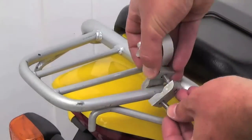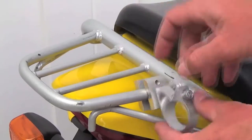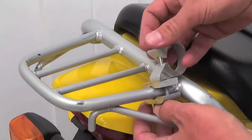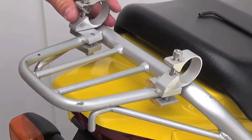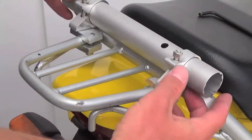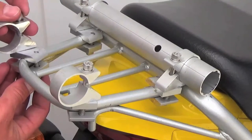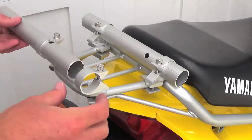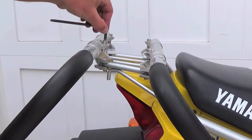To install, partially disassemble the clamp sets until you can slide them over the moped rack bars. Reassemble and lightly tighten the first clamp set, then repeat for the second. With both clamp sets in place, you can slide the mounted tube into the clamps. Repeat the process for the second mounted tube, and then take some time to dial in the rotational alignment of the mounted tubes before proceeding to tighten them all the way.